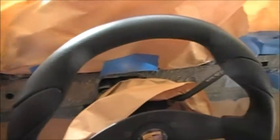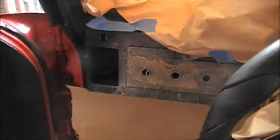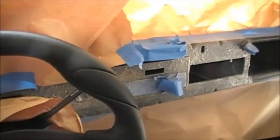I'm going to attempt to change the seal up here along the front, but that may have to wait for the window to come out — I've got a cracked windshield anyway. We'll clean that up and put the new dash in. While I've got the dash and knee pad off, since my old dash face was really nasty looking — all dried and peeled — we've got the basket weave style material and we're going to put a brand new dash face on here. We've got it all masked out, sprayed with contact cement, and we'll let it dry and stick it on.